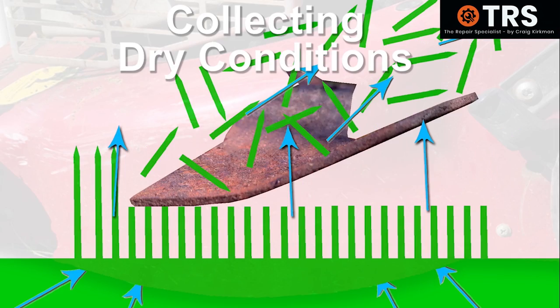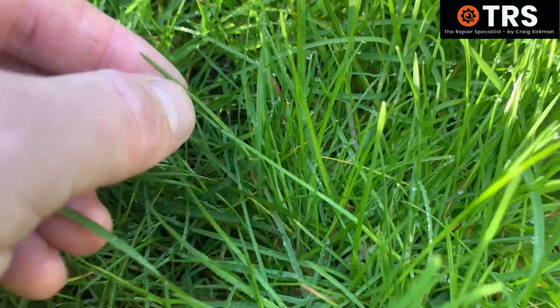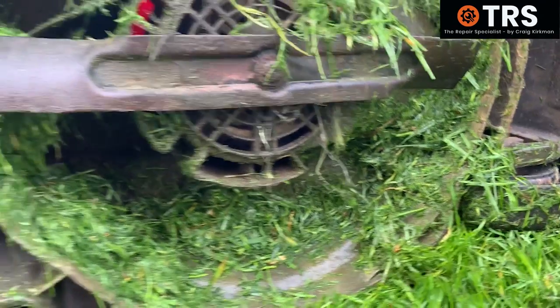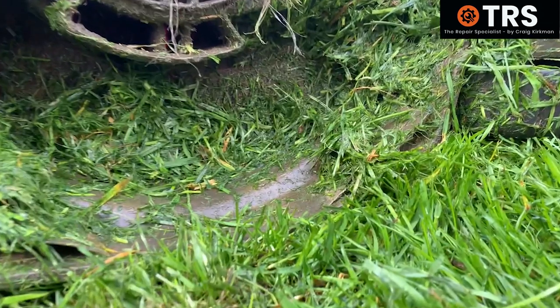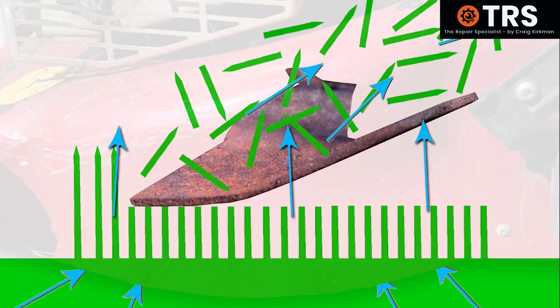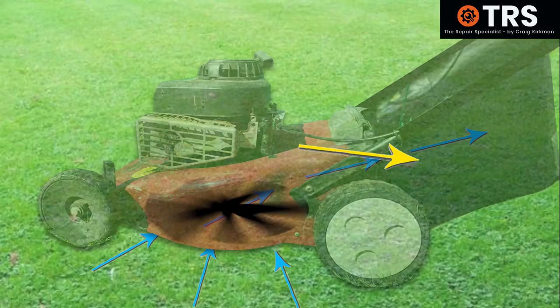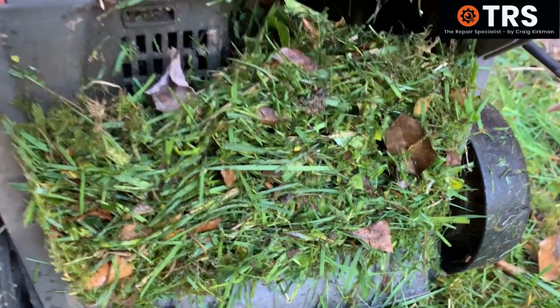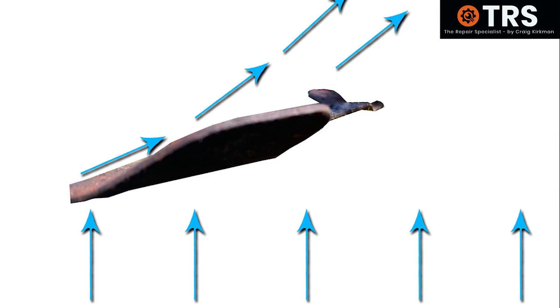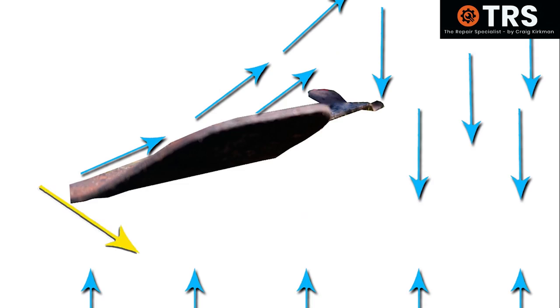Collecting the grass is all well and good in ideal dry conditions. But when the grass has water droplets attached to it — even quite a small amount of dew — these droplets cause the chopped off pieces of grass to clump together and also stick to the underside of the mower. One of their favourite places for clumping is indeed in the chute that goes to the grass box. The main purpose of the collecting blade is to create that higher level of air flow than the mulching blade so that it can get the grass into the collector. But the air no longer has a clear run right through past the blades to the grass collector. That much higher pressure wind now hits the top of the deck and then pushes back down towards the grass, thus somewhat cancelling out the lifting pressure.